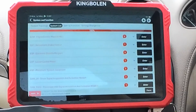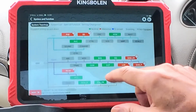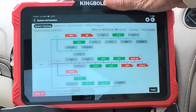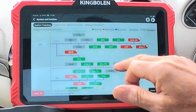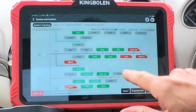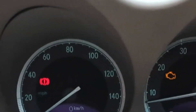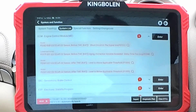It's come to 100 percent now and reached the end of the list. If you go to the system topology you can see it will tell you in all areas of the car where the faults are. The audio system has an issue - I actually took the command unit radio out just yesterday as I was trying a new screen, so that's probably why. The system list puts them all at the top, and the one I'm interested in is the engine control module.